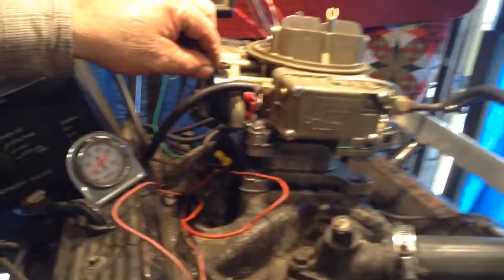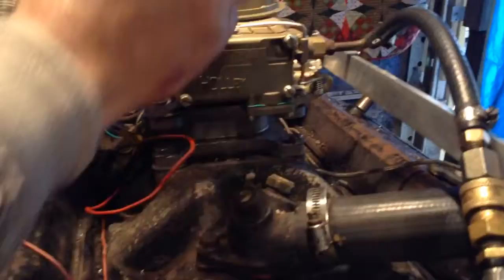It's your carburetor, but you basically spent $250 to get it rebuilt. Whoever had it apart when they were doing this coating — this thing was on backwards. There's a bunch of parts inside that weren't correct, and we had to do extensive modifications on the inside to get it to burn today's fuel — ethanol.